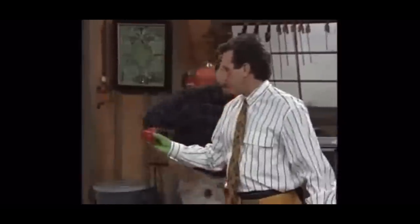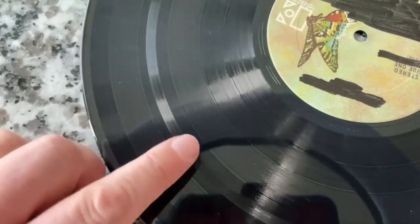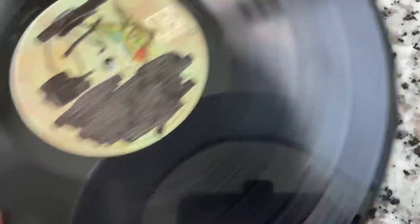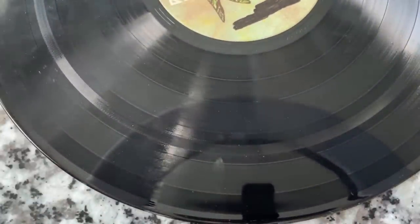So to the people that think you're going to damage a shellac record by playing it with a micro groove stylus at five grams or less — I don't think so, Tim. I honestly thought we would see a wear ring that clear as we got up to eight grams with the other stylus. Let's flip this over — one more look here. This is completely featherweight compared to this. The lesson here is I wouldn't worry about things tracking five to six grams. You may not want to put on your prized records, just for the standpoint that they will wear faster. It's mathematics that it's going to wear faster than something tracking at half that weight. But is it just going to arbitrarily damage your records? I don't think so.